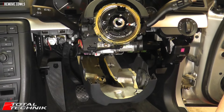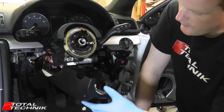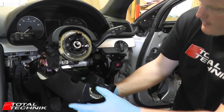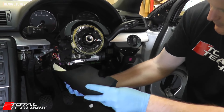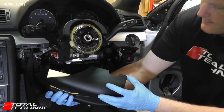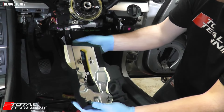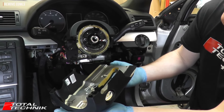There's a little trick to getting the cowl off — the only thing stopping it coming off is the lever for the steering wheel column adjustment. The trick is to twist it at a slight angle. Put it over, twist it, and take it back — and you can get it off. That is your lower steering wheel cowl completely removed from the car.